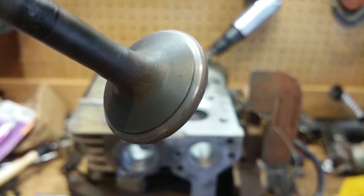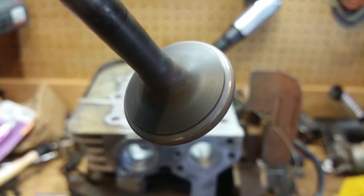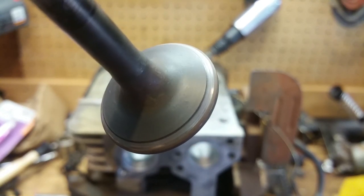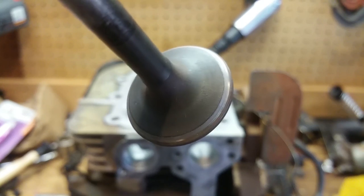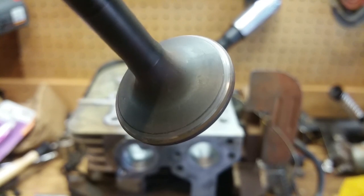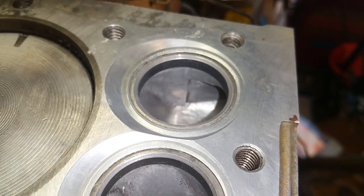There's the exhaust valve. The exhaust valve was a pain to grind because it's way harder metal — obviously because it gets so hot. It's a way harder metal so this was a pain to grind and it didn't grind hardly at all, but I did the best I could on it. Now I've got to set the valve lash on this thing, so let's take a look at the seats real quick.